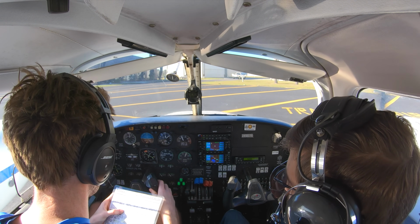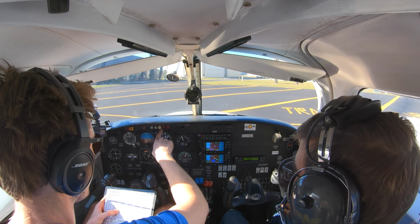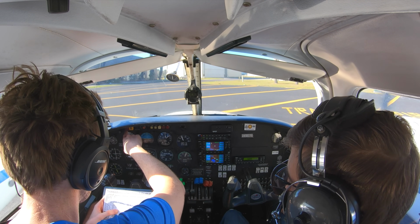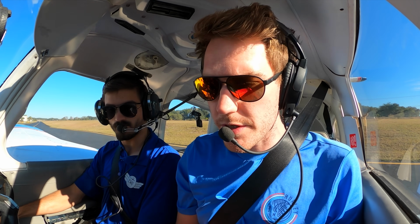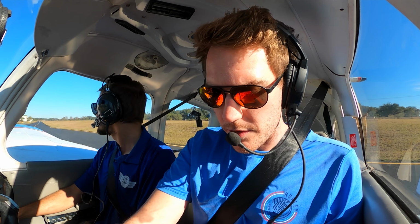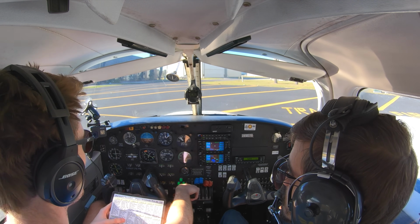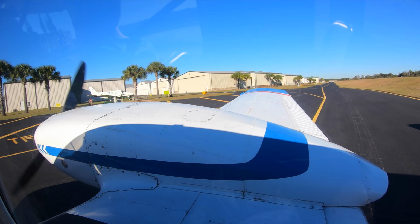We're all looking good. Test the annunciator lights. Oil vac out. Okay. Over temp. Low bus. Gear warning. Gear warning. Oil pressure, oil temperature, we've been checking that throughout. Temperature's fine, pressure's fine, fuel pressure's fine. We tested the annunciator lights, the idle check. Nice and easy.